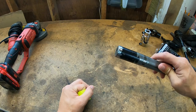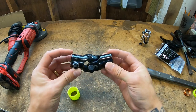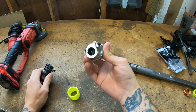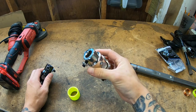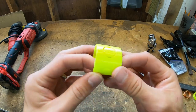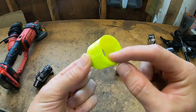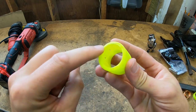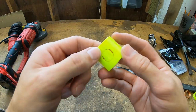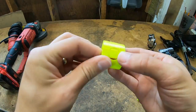To review: this piece needs to connect the original steering column from the 240SX, which no longer has a joint on it, to this Flaming River universal smooth bore to three-quarter inch double-D, where it will meet up with the other joint that goes straight into the original Nissan spline connection. So what I did was I made a cylinder - on one side it has the original 240SX steering column diameter, and on the other side it has the diameter for the smooth section of the Flaming River piece.